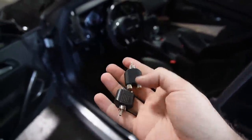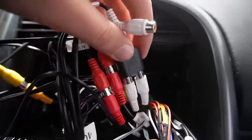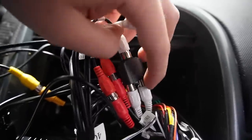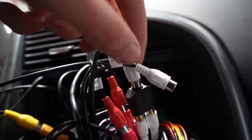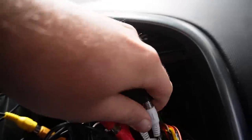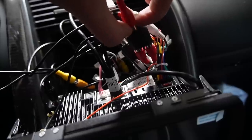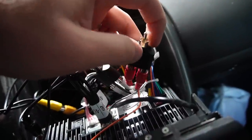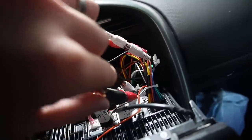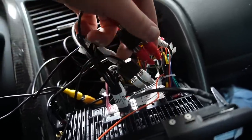I have my cables — these red ones — red to red, red to red, and this actually caused a lot of staticky sound. The way to fix that is by literally just using this adapter. I have the two whites that go to the out wire — there's an out and there's also an in. We're going to use the out cable and connect it to this adapter, and we're going to do the exact same thing with the red — hopefully that should fix our static sound. After a little bit of messing around, I figured out that this splitter basically has pins on top that are kind of loose. I just pressed on the pins — you can see there are four pins like guide rails — just push those inwards a little bit so it makes better contact. I noticed that the static went away, super happy about that. Now I'm going to go ahead and just tape this all up with electrical tape.